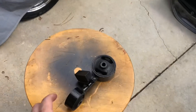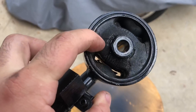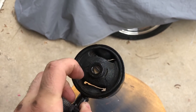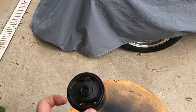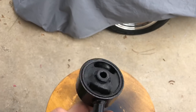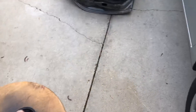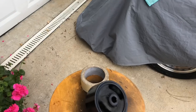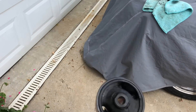If you look here, the mount we're experimenting on has cracks all around the center. It's made to have that little groove on the side just to add a little bit of play, but they always break. You can see the movement right there — and with the torque of a car when you take off, that just loads backwards right here, so the top of the engine actually rocks backwards.